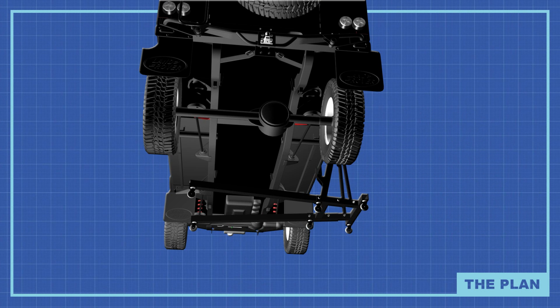Some owners choose to follow a similar method, but only move the gearbox backwards several inches. This saves you a few hours on labour time, but the clearance that it gives is minimal and makes swapping the clutch release bearing incredibly difficult using this method.